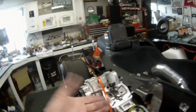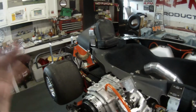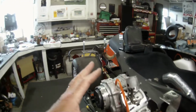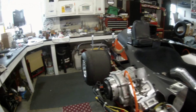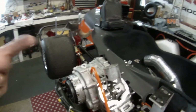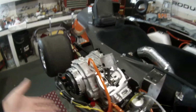I think what happened, we were about 142 to 145 maximum of a lap on water temp. Not sure exactly what the water was doing at the time of the breakage, but even if it was 145, that's a maximum number. That's not hot. Exhaust was at 900 degrees. That's not hot. And I was literally babying this thing. I couldn't have gone any easier or any slower than I was going without literally the motor dying.